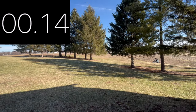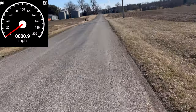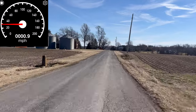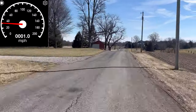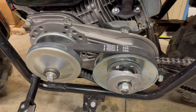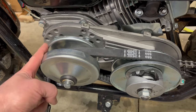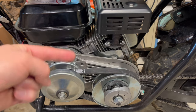There's the hill climb with the torque converter. And here's the top speed test. We got better torque and speed than a jack shaft, but not quite as fast as a straight chain. That's actually because our belt wasn't rising to the maximum level — it only gets up to here at 4,300 RPM, and we're governed to 3,600. I'll do a future video on RPMs and general engine performance. But right now, we're sticking to gearing.